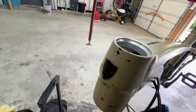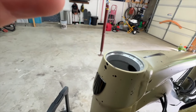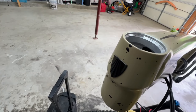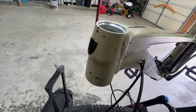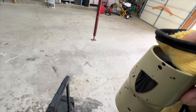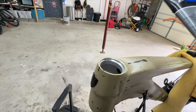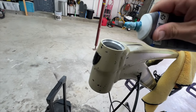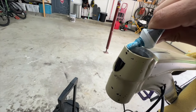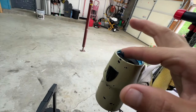There's some marks in there — not sure if it's dirt or scuffing on the aluminum. With semi-integrated headsets you have removable cups, so if your cup gets damaged you can punch it out and replace it. With this integrated design, the frame might be compromised if it wears out. Grab your grease of choice — I've been using Park Tool grease, a four-ounce squeeze tube I've had for about three years. Put a pea-sized dab in and rub it around — just a thin layer will do.